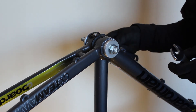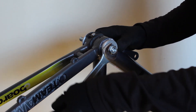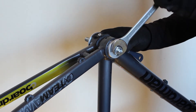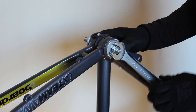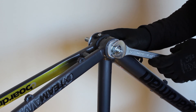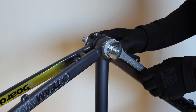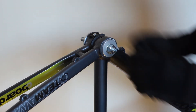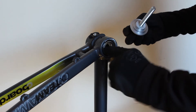Using two spanners — hold on the right side and turn on the left side. As you turn the spanner, nice and easy, gently does it, it pushes the bearing in really straight. The tool can't move, can't go off centre. Again, the only thing that's rotating is the nut on the left hand side — the bearing press plates, both left and right, are completely still, they're just moving in. As it tightens up against the circlip, just give it a little bit more of a tighten, then back it off. Remove the tool — and there's bearing number one, perfectly installed.